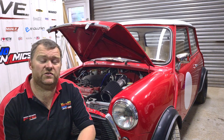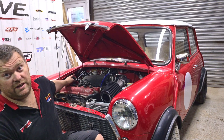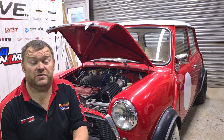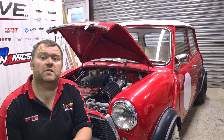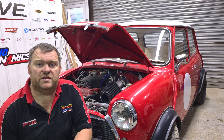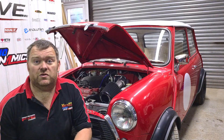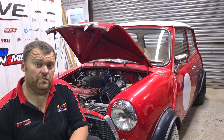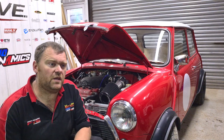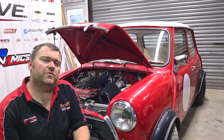We're going to fit the Max ECU Street. Because it's the later engine, someone has already fitted an external coil pack - a Ford one. We're going to go to coil on plug because it's got a cam sensor in the end as well. Looks like the Bosch setup. I've never done one of these engines before but it's a basic enough engine. Most of the sensors look like Bosch. It's got some different bits - like a speedometer drive and an internal tachometer.